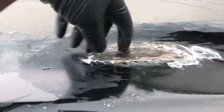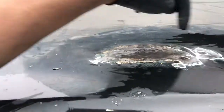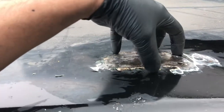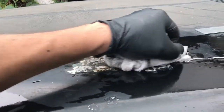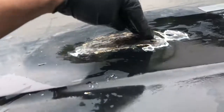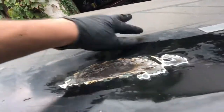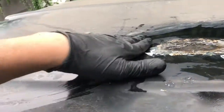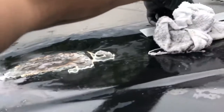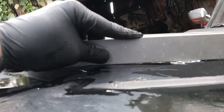So what this is, this was stretched, so it heats the metal. And this is all cold over here, so it can't go anywhere. So it kind of goes in on itself. So then you have to quench it with a cold towel. And that makes it all solid again. I mean, I took a lot of it out. It looks like it moved it this way. That's what they're saying, if it can move to other areas. But took that down. You can see there's definitely a gap.